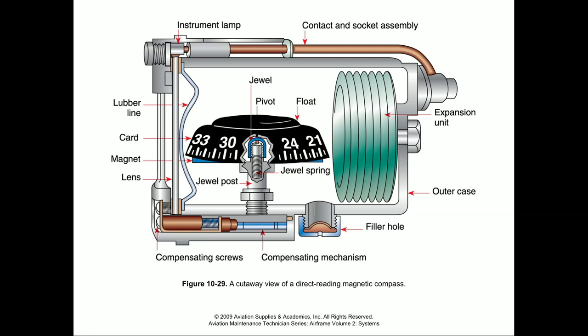This pivot allows the magnet to accommodate increases and decreases in pitch, or banking. Obviously it can run into issues if the aircraft is inverted, but ultimately it does a pretty good job. It's not perfect — it's subject to a couple of issues, one of which is electromagnetic interference. If we have anything near the compass that produces a magnetic field, like wires going to a light or to the instrument lamp right here, they're going to produce an electromagnetic field which will cause some deviation in the compass.